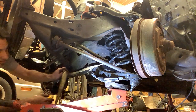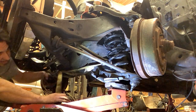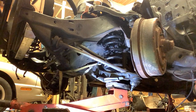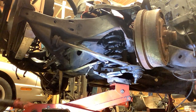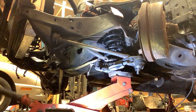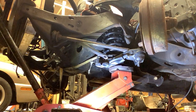Obviously, don't get your hands in the way of the spring — you'd never want to. Can't trust these tools; they'll let loose on you. You want your jack as far out on the outer edge of the control arm as possible, otherwise you ain't got enough leverage. The motor being in it helps a lot. That's it right there.